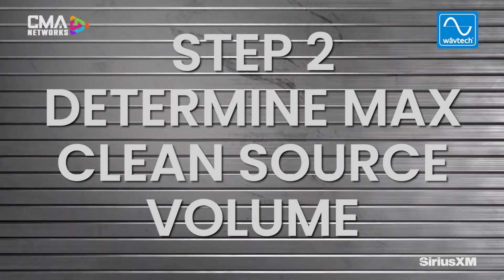Secondly, it's a bass restoration processor. That means that it allows you to restore bass and music content that's not there, older 80s rock and roll music, band music, things like that that don't have much bass in it. It allows you to take the upper bass frequencies, shift those down, boost them up, and get incredible low bass, even with music content that has no bass. As well as it allows you to correct for bass roll-off and frequency response issues from whatever source that you're tapping into.